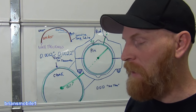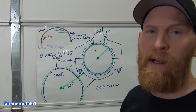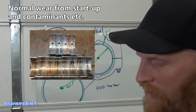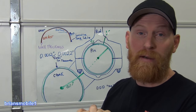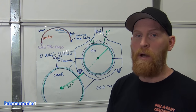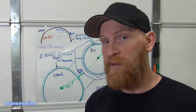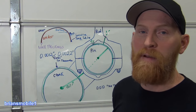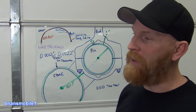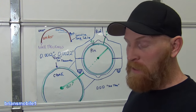A tri-metal bearing will have steel, then copper alloy underneath that, then a stronger material on top that doesn't wear as well or absorb particles and inclusions as well. So: tri-metal, bi-metal, and mono-metal. The advantage of mono-metal is that you can have soft crank, hard crank — doesn't matter what material it is, it just does good. But when these wear out you have to get new ones. Have the machine shop pick them out because it is a jungle out there. When I went to the machine shop for this 4Runner they asked me all those questions: Are you running turbo or is this naturally aspirated? Is this something you want to last a long time or get together on the cheap?